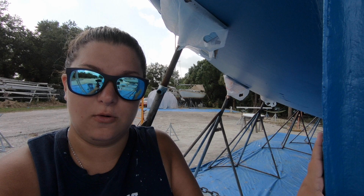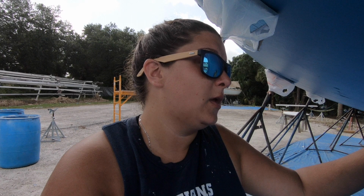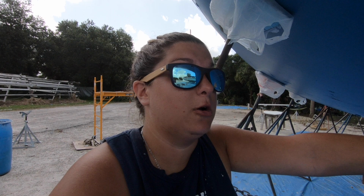So, needless to say, we're not happy right now. Pissed off is the word I'm gonna use. And we got a hold of the store we bought the paint from. We don't know if our barrier paint, which was Interlux Protect 2000E, we were sold a bad batch or what. Feels expired because we followed all these steps textbook. Like we applied it textbook. So we're dumbfounded. We don't know why it's doing this. I'll let y'all know what we end up having to do, but it sounds like we're gonna have to strip all this paint off. We just got set back a week.